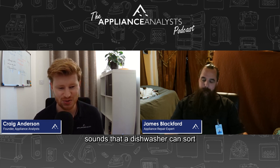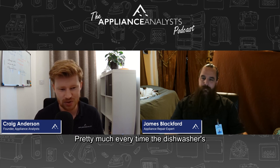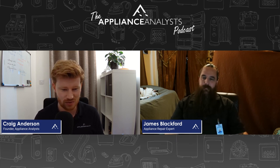And then I think we'll start going into the different sounds that a dishwasher can make that might be letting you know something's going wrong. So if there's any general rattling that you regularly hear, you know, it's not a one-time thing. It's pretty much every time the dishwasher's on, there's a rattle going on. Is that a common issue at all? Yeah, usually a rattling happens during a drain cycle.